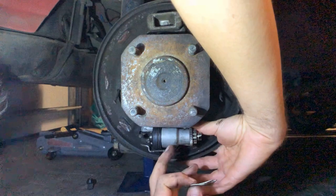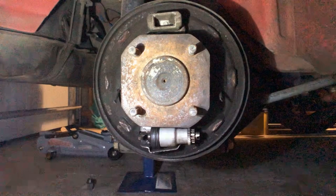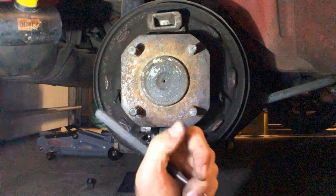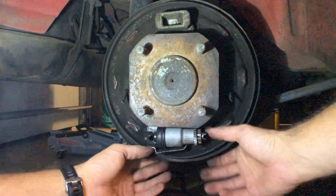Getting this small one in around the big U and the handbrake levers is a bit tricky, so you just have to work at it. Ultimately you get that so far by hand, but you'll need to persuade it with something a bit bigger. I'm not restraining that big U by anything but friction, so you can often, with a good precise hit with your hammer and your drift, knock that smaller U into shape so those dimples lock in. All right, so they're in.